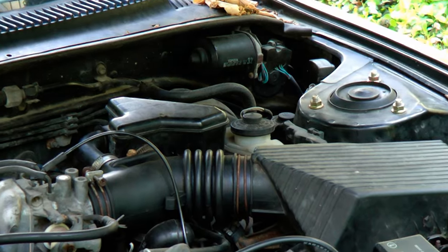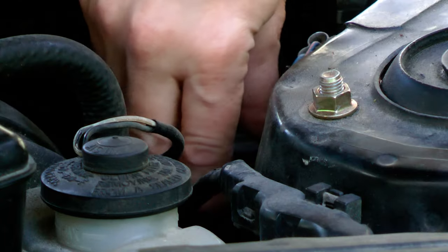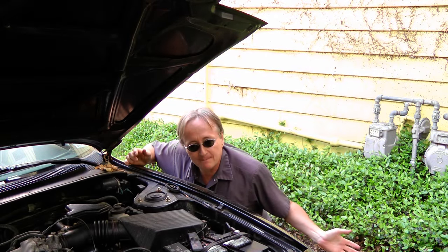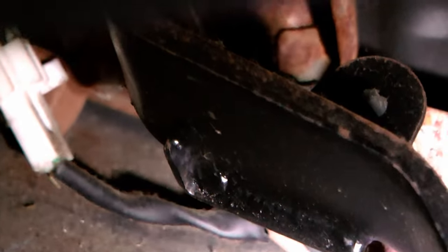Your cars use hydraulic clutch cylinders — it's not the brake cylinder, but it's next to the brake cylinder, right here. Pull off the top and look inside. If you don't see any fluid, then it's leaked out and you have to find out where it leaked from. So pick up a little flashlight, look up at the top of the rod, and if you see fluid coming out, you know that the master cylinder is leaking.